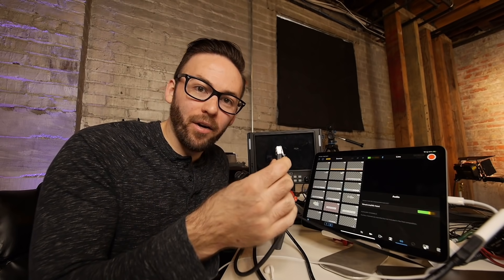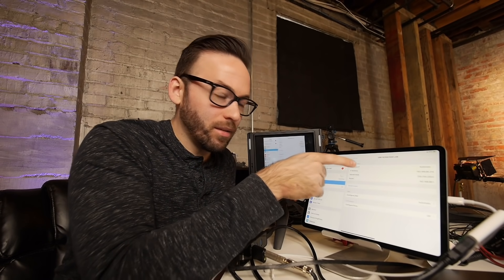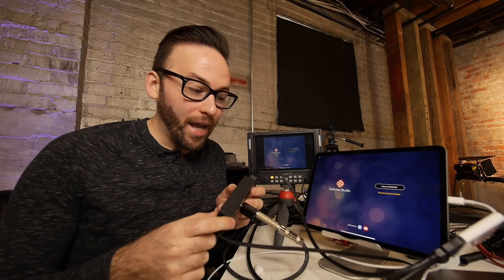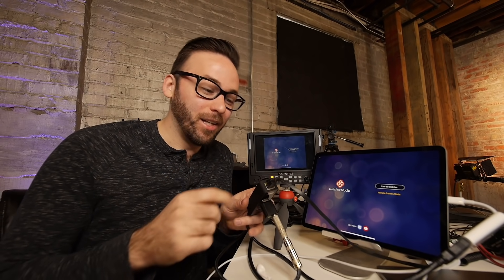Let's also do wired internet. I'm going to go ahead and plug this in. To double check the internet, I'm actually going to leave Switcher and go to the settings of the iPad. If we go here and we tap on ethernet and look at this — I've got an IP address. So what we've done with this iPad is turned it into a live streaming audio visual powerhouse. We've got HDMI video output of the live feed that we can send to an external monitor, a projector screen, or anywhere else. We've got ethernet hardwired in so that if we're concerned about connectivity over the air, our main switcher has a hardwired connection directly to our internet gateway.